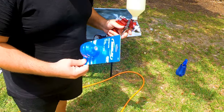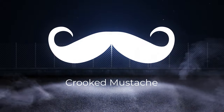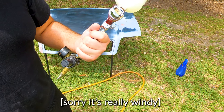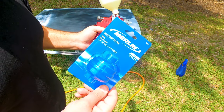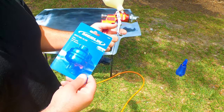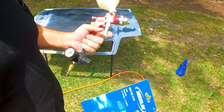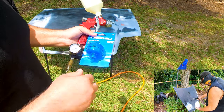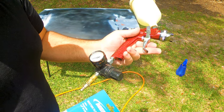I'm really excited — we're actually gonna get paint on the car today. This is our spray gun, it's an old one but works just fine. This is the first time I've ever used it for auto body paint. This is the moisture filter we're gonna be installing. I haven't had any moisture come out in light use, but when we were using the media blaster I was getting moisture in the tip, so I'm putting this on to minimize that possibility. Then we'll hook up the line and start shooting primer.